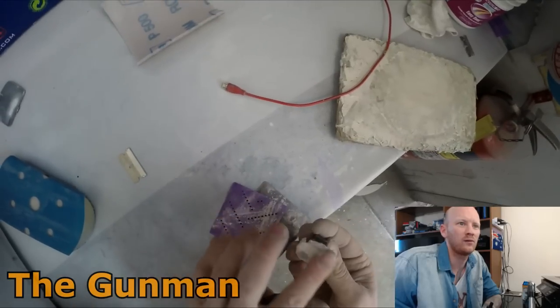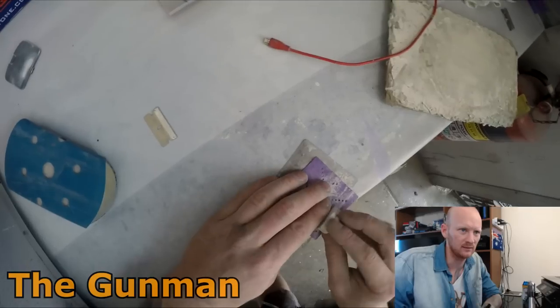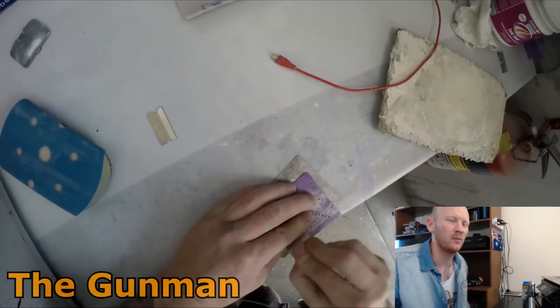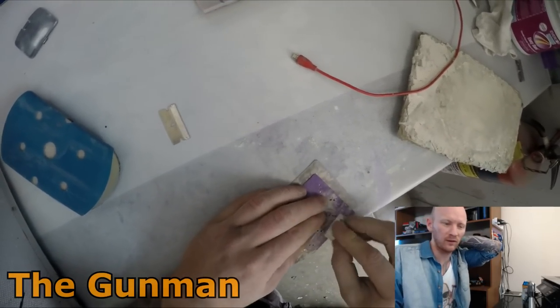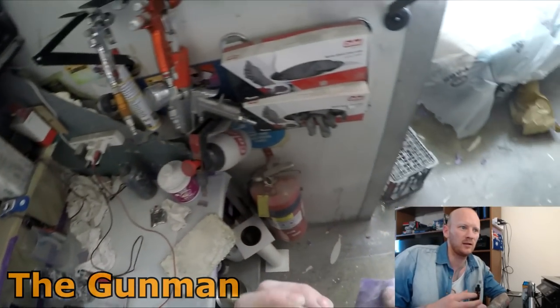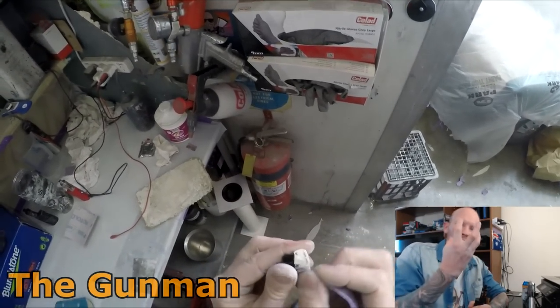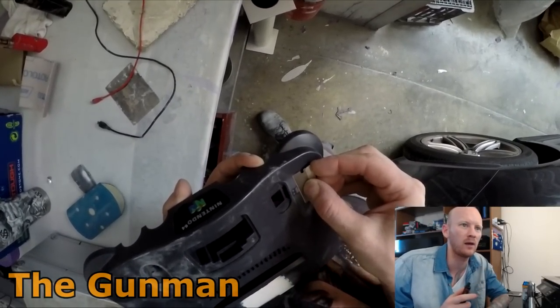So again, just using some 180 grit, as I mentioned before, on these areas that were a bit rougher, they needed a bit more sanding, and finishing everything off, even all of the fillers, getting finished off with 500 grit. Just less chance of having the sanding scratches, the primers shrink back into those scratches, and possibly sand them later down the track.